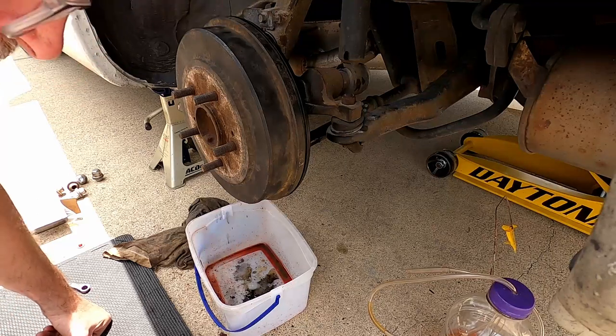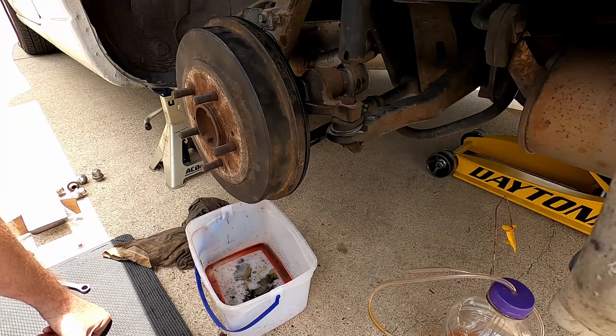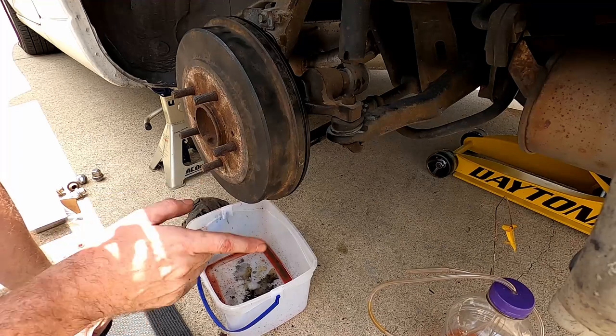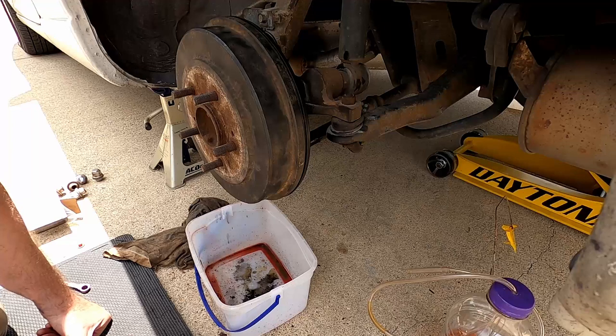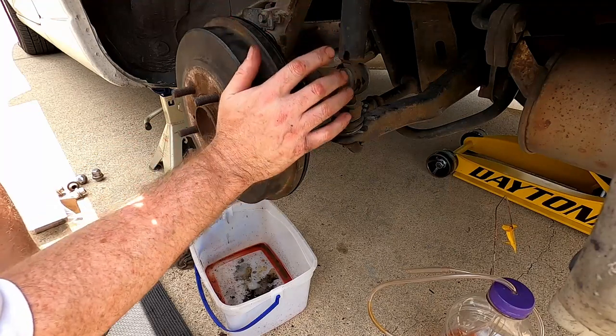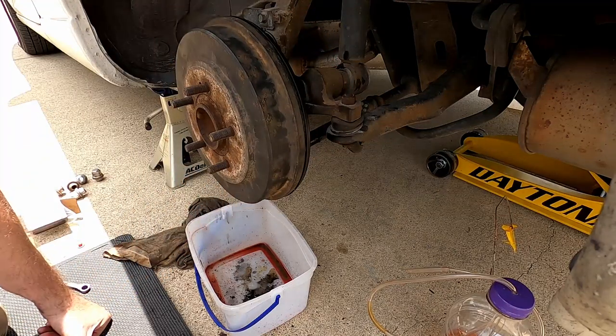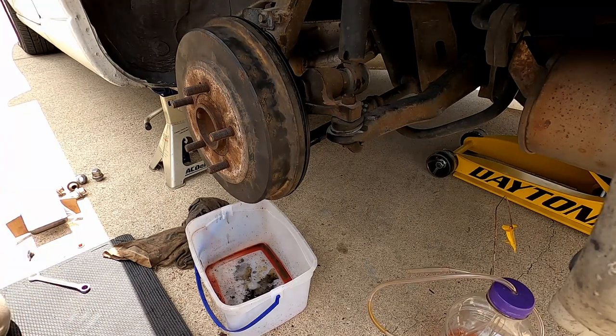It's not leaking, so it should be good. After you put the tires on, set it down, start it — make sure you check the brakes and have brake pressure before you start moving. Also: you want the parking brake off, so have it in gear or in park with a chock in front. You can't have the parking brake on or the drum won't come off because it's engaged. I hope that was helpful — please like, subscribe, comment, and good luck.